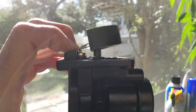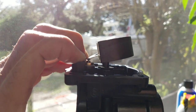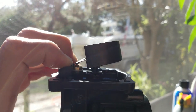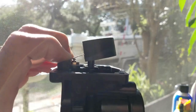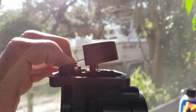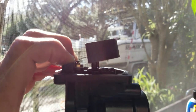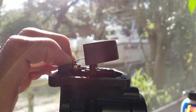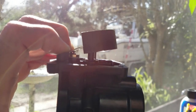This is interesting — this is how the old float was set up, and it kind of explains why the engines tended to run out of gas. This is only one of the four on the starboard side — eight total carbs. They tended to run out of gas, and it wasn't like something was wrong with the engine. A couple of times I'd squeeze the bulb in the gas line and they wouldn't stall. This has to do with the float — it determines how much gas is readily available in the float bowl for the carburetors to feed to the engine.